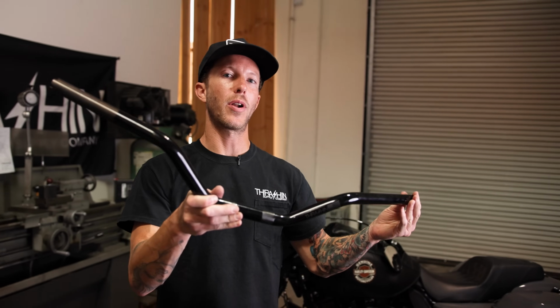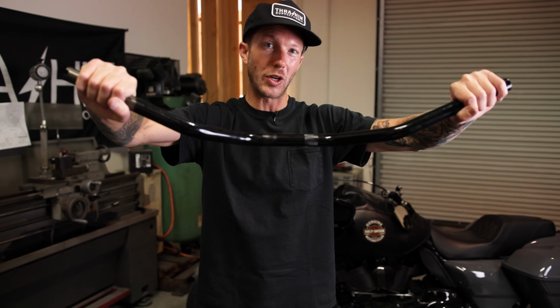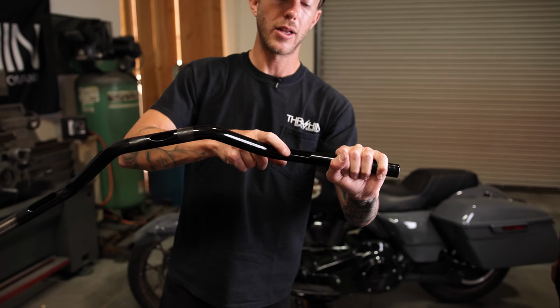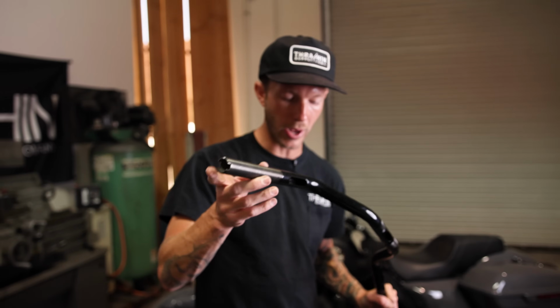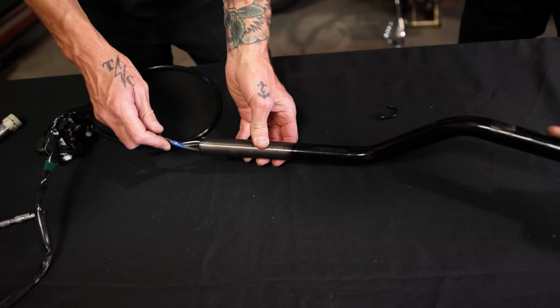The owner of this bike wanted to set a mid-bend bars on his setup, 4-inch rise, 25-degree sweep. My favorite handlebar, made in America, and we have the cutouts to do all of the wiring and the throttle by wire keyways. The nice thing is all the wires fit. Make sure you put the right ones on the right sides before you run the wires through and then you realize, oops, this is the wrong side.